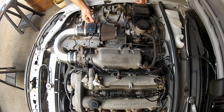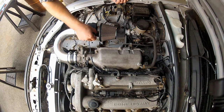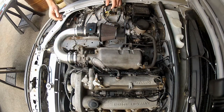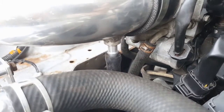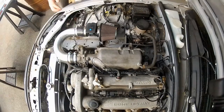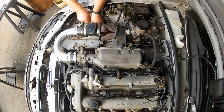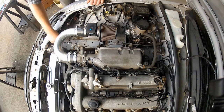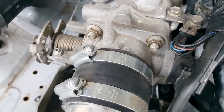I'm going to unplug the MAF sensor. Next, I need to unplug the intake air temp sensor. Then we've got a breather hose underneath the intake — I need to pull that off. Now I need to remove the bracket from the inner wheel well here, which just requires a 10mm spanner. Then finally, I just need to undo the clamp holding the intake to the throttle body, and then this whole lot should just lift away.